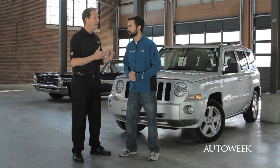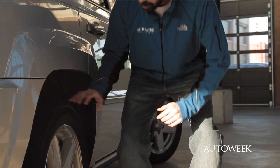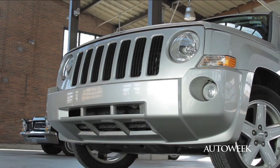If you can't find any shade, work early in the morning or late in the afternoon — that's going to be the best possible thing for your finish. Coming out of winter, you'll always want to wash your wheel wells really well, your wheels, your tires, under your fenders. That's the time to get rid of all that stuff mother nature has left behind on the roads. Be sure to inspect your underbody including your brake and exhaust components, and look for rust, holes, or anything that could cause a problem in the future.